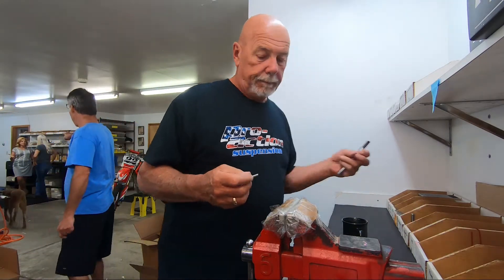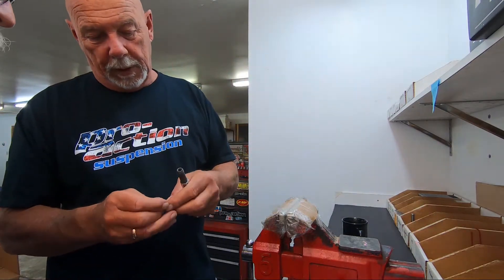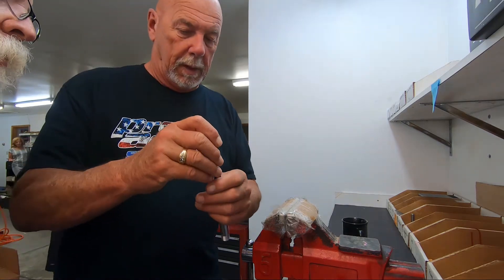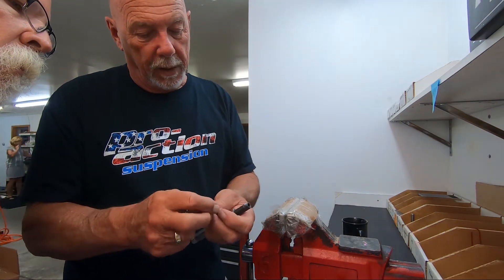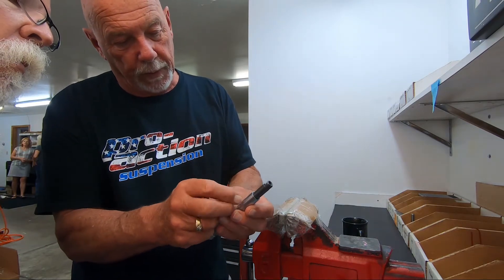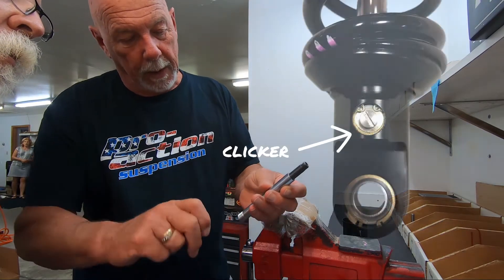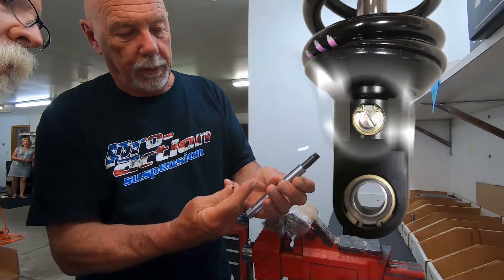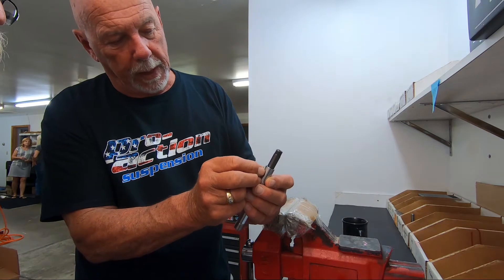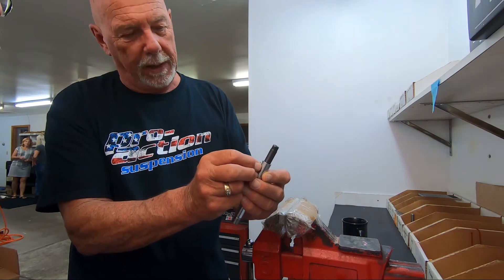Now that jet — I need to take the o-rings off this. The pin sits on a shell down under here. When you turn that clicker in, it drives the pin up. It changes and moves this up and down on the inside. That's the damping bleed.